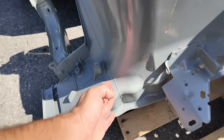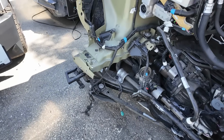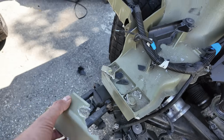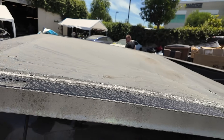With the Cybertruck, this is impossible. There are no side rail extensions — the entire front structure is one massive casting that extends all the way to the bumper. Even if you slightly damage the tow hook that sticks out of the bumper and attaches to the subframe, the subframe will break off and break the side frame rail. God forbid you don't have insurance, because you'll have to replace the entire front end of the car.